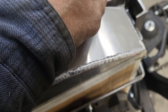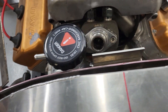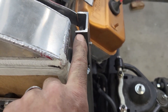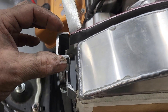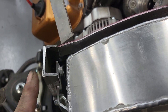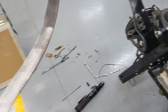I'm establishing a point where I want this to marry up. This side will come up and around and marry up with this side. I'll probably carry that taper in so this will be chamfered down a little bit. This is inch-and-a-half and I'm going to band this whole thing with inch-and-a-half. I'll probably attach it through the top — whether I do a break in there for flat on the top or continue on down — I'll need a method of fastening it in.